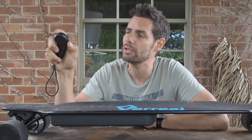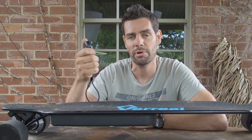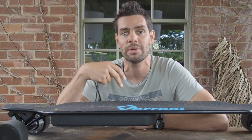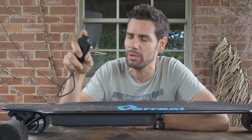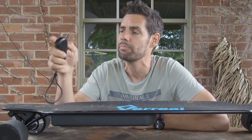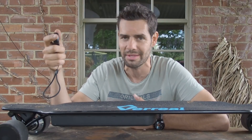It doesn't feel like it's going to fall apart. The controller is a thumb wheel which actually works really well and has a reasonable stroke on it, so you have quite a lot of control in terms of accelerating and braking. Braking applies regenerative braking through the hub motors, so as you go through the braking phase it puts energy back into the battery to extend your range. The reverse mode is not activated with a tiny silly button on the handle that you can easily knock by mistake - instead it's got a real positive switch on the back that you have to deliberately put on or off, so there's no situation where you'll end up in reverse without realising.